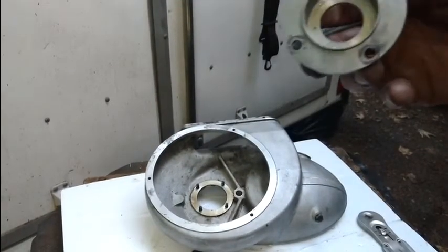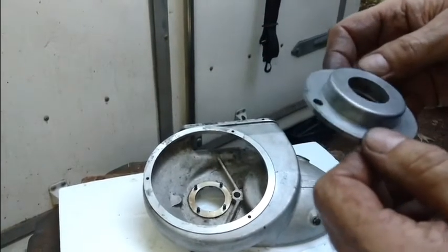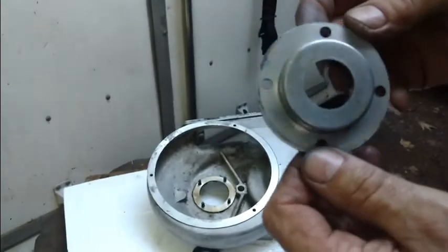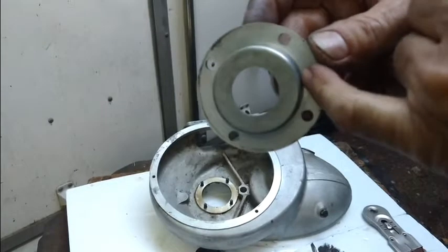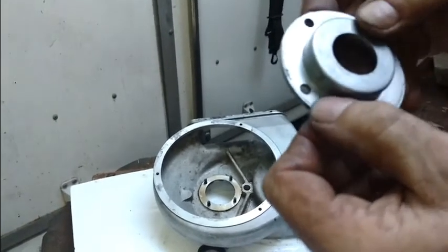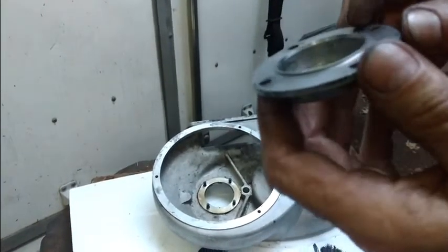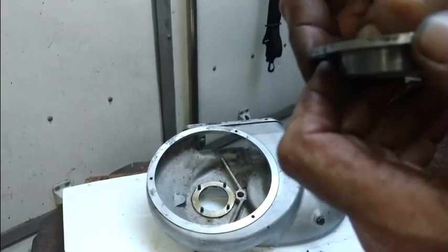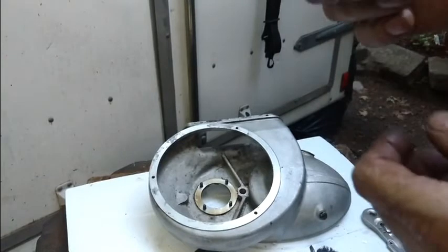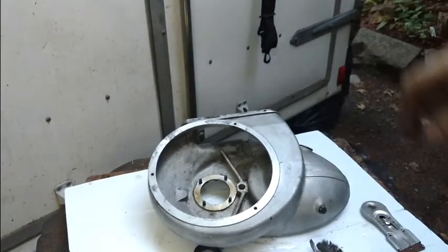After a few minutes with paper towel, some brake clean — which is essentially alcohol — a careful use of a single-edge razor blade, and a small wire brush, the seal adapter is pretty clean. There's a groove machined in it that was a challenge to get the sealer out of, but it looks nice and clean now. There's some staining, but the wire brush wouldn't take it off and it's not material that will interfere with sealing. The inside of the holes should be cleaned too, to ensure it won't interfere with whatever position the adapter needs to be in. That's ready for the new seal.